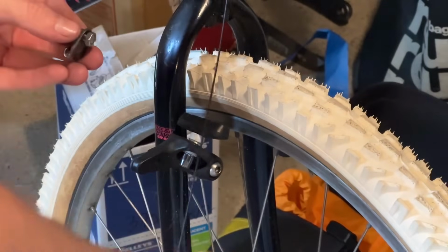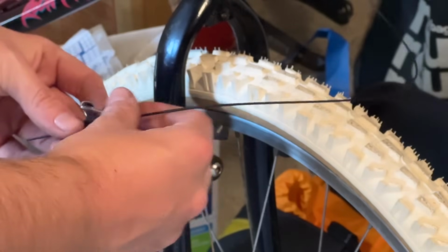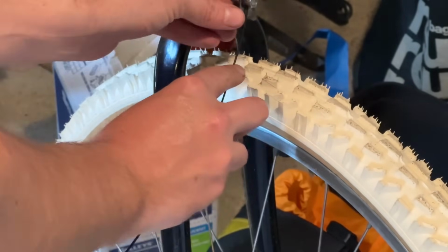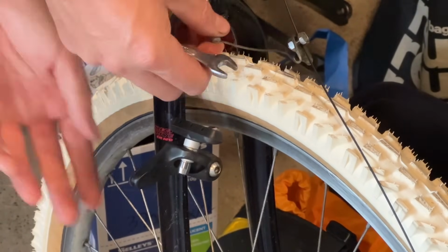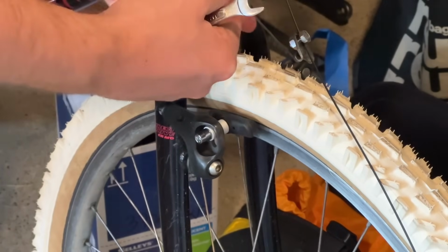And these brake pads have to be on a bit of an angle to make them hit properly. You could use some washers and stuff to space them a little bit, but you end up running out of thread on the post, so just keep that in mind. You don't want to use Cool Stop thin line pads as well because they're just too narrow.